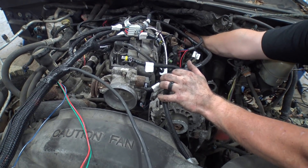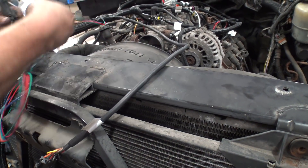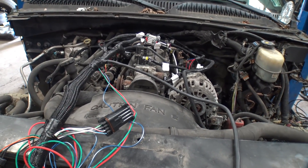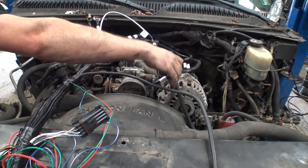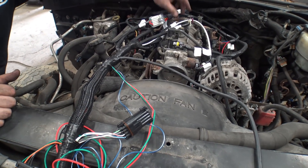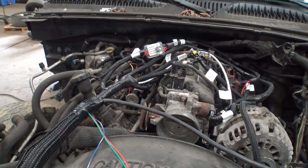Holly has a thing where they have a built-in MAP sensor on the ECU - you don't even need to use the one in the car. I'm going to try to use that this time. I always use the three bar because I do turbo stuff. That's for the O2 sensor, this is for the fuel pump and stuff, and my flex and alt harness plugs into that guy - pretty cool new thing on the harnesses. We need to plug in cam position, cam and crank. Oil pressure - some year trucks have a different plug for oil pressure, but Holly puts the same plug for all their sensors.